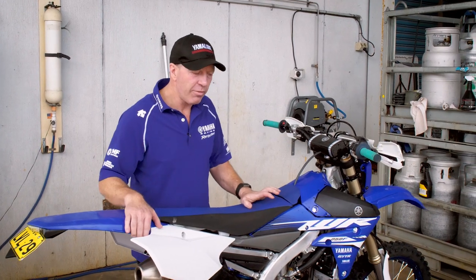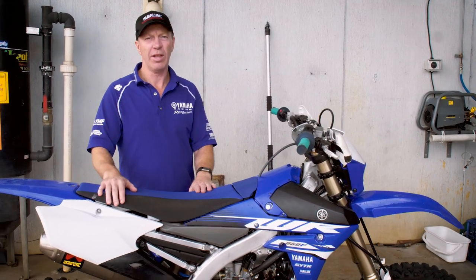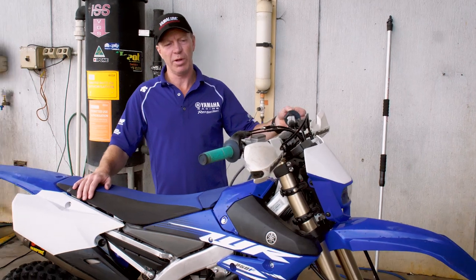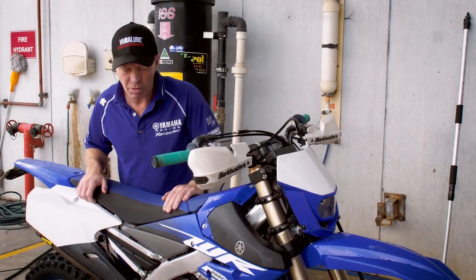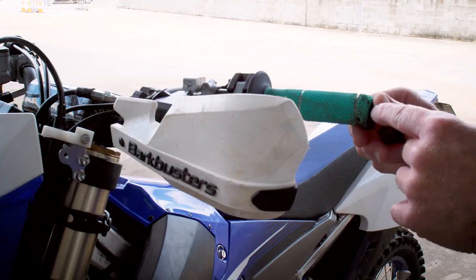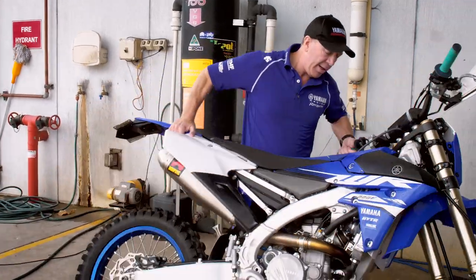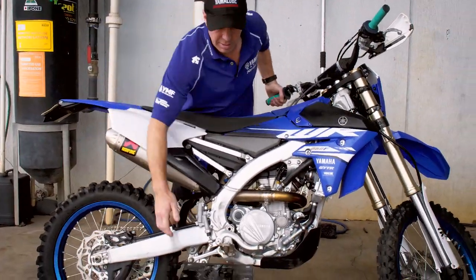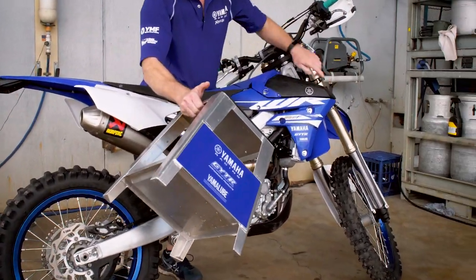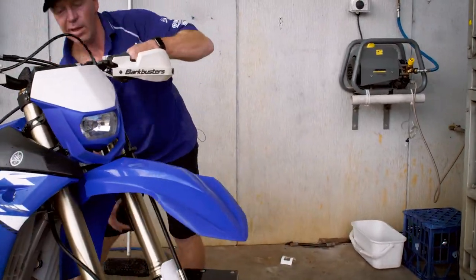A tip I have for people that have really dirty, muddy bikes is putting it on its side to give it a wash. Most people will just lay it down on a grip against their stand or just lay it on the concrete on the side, and that's a good way to rack your grip. So a tip I use is take it off the stand, and use the stand to sit underneath these four pinch bolts here. So then you're not going to tear the end off your grip.